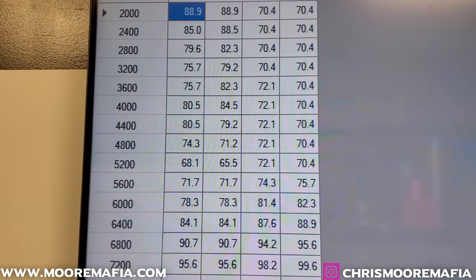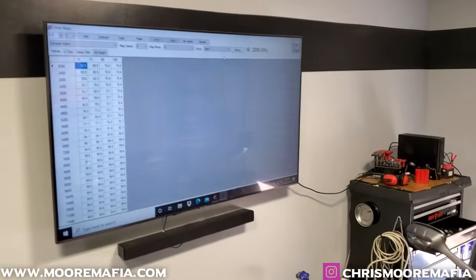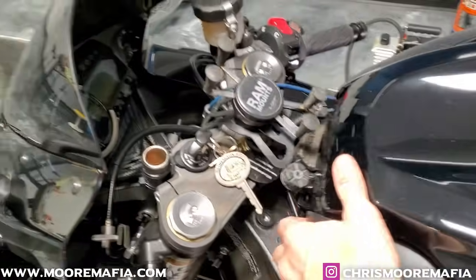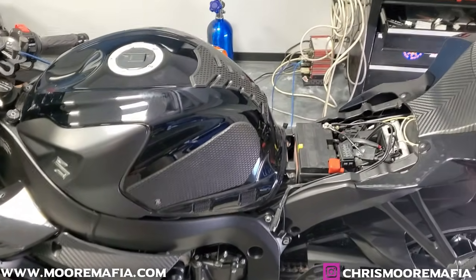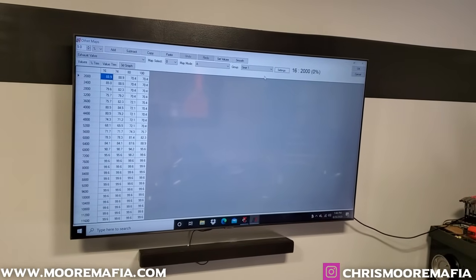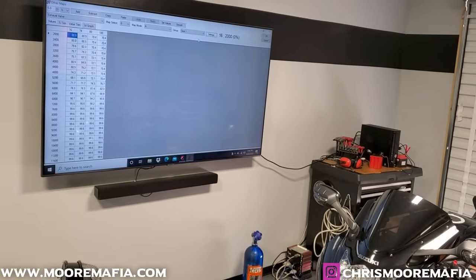You can see the exhaust valve — it is slow to open, but it does open and stay open. We open that 100% of the time as well. All these things really help with the low-range horsepower and the overall horsepower itself. We also adjust the fuel tune on the bike for the exhaust system and the cat delete. The ECU on this bike is located right there. I have a full tutorial on what you need, how to remove it, and the tools you need on the YouTube channel — you can click the link in the description below. I just wanted to show you what we were doing and how we were getting more horsepower, so you can decide whether you want to send your ECU in to see these gains for yourself.